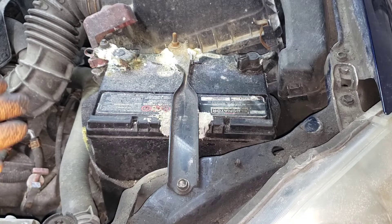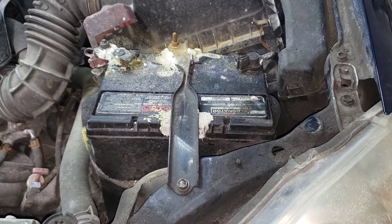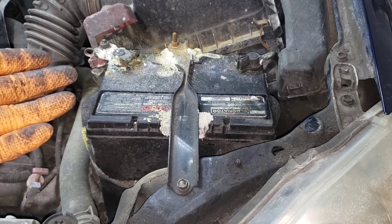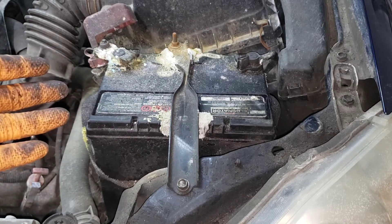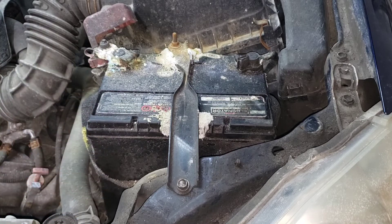You can also do that with the battery to make it look prettier, but keep in mind — if the gases can escape, that means you can also get stuff into the battery. If you're putting something that neutralizes acid into the battery and it gets in there, you're going to kill the battery. So just replace it — that is the best thing to do.